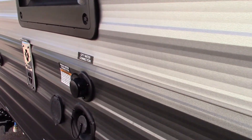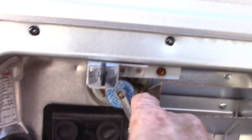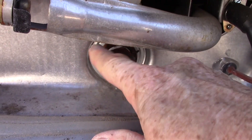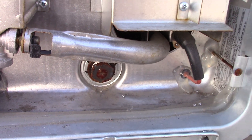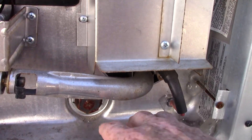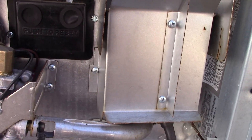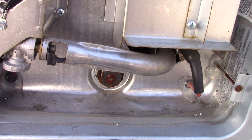This is your water heater on the outside; it works on gas. This is a vent to vent the tank, and this is your plug — it's a one-and-a-sixteenth inch six-point socket. There's an anode rod on the back, about eight or ten inches long. The most important thing: never vent it or remove the plug while you have hot water in it — always make sure it's cooled down. Vent it before you pull the plug because there's pressure inside; if not, it'll come shooting out like a cannonball with a gallon of water behind it. If you let it cool down, just vent it and then remove the plug. The switch to operate it is inside.